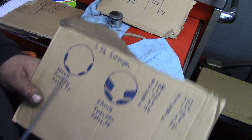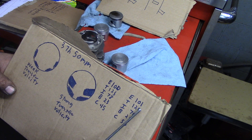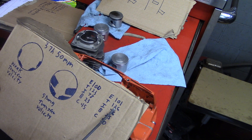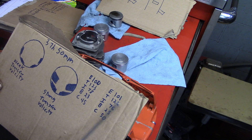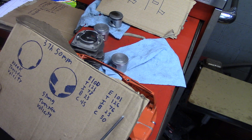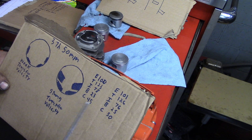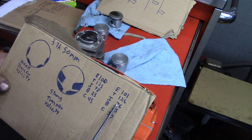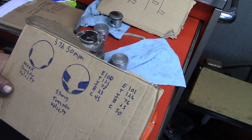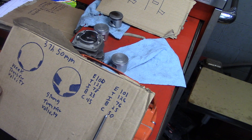This is when the light bulb went off in my head — what can I do to increase this? I can try to bring my transfers down a little better. I got 126 on my primary transfer, 127 on the secondary. When I cut the cylinder, I took about 35 thousandths off, which brought that down. And I JB welded my intake to 76 — it was at 82, which I wasn't happy with. So I took 126 minus 76, equal to 50 degrees of case compression.